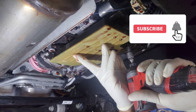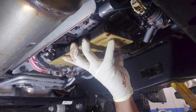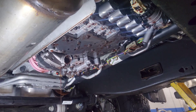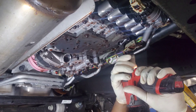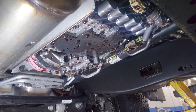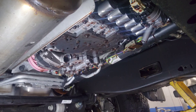Right now I'm taking the filter out. The bolt for the filter is one-time use. This job is on the warranty, so when I ordered the valve body I ordered all the one-time-use hardware. Most of the bolts on the valve body are one-time use — they are torque-to-yield. You have to replace them with the specified bolts. They are different lengths and you need to know which bolt to remove when you're doing this.